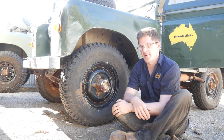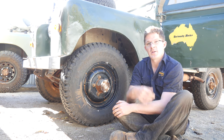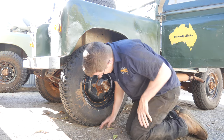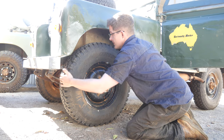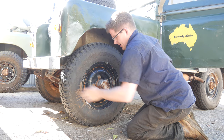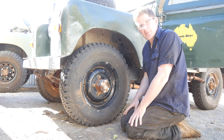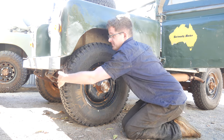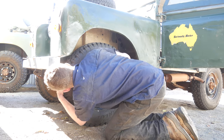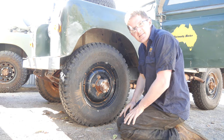So I think it's pretty important to check it regularly. This is something I didn't know when I first owned this vehicle — it's something I picked up from listening to and talking to people over the years, and finding out for myself. Basically what you need to do is you can either jack up the vehicle, or you can just give it a good old move, and you can just feel the slop. You can hear the steering wheel actually move. If you're not too sure about it, get a helpful friend to look around the front. That seems all right, because I've actually tightened the nuts up recently at a service.